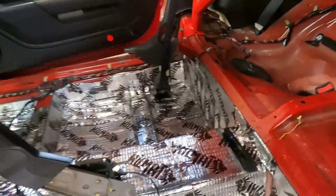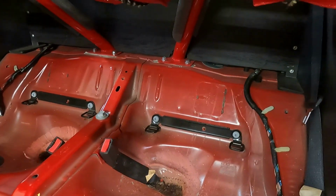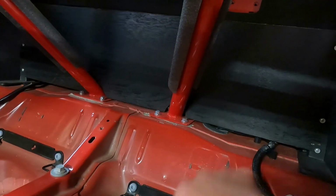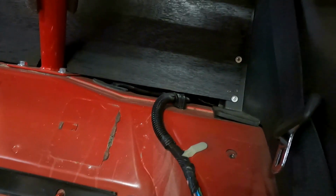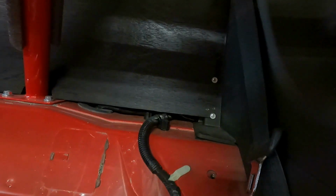Well, that got her done all the way up to where the back seat starts right here. It goes back in there, and it's a big old thick piece of foam, so I've got a theory that that's a pretty good sound stopper by itself. But when I put this piece of wood in here in the back there, because I had to take the back seat out and left that hole where the trunk is, I put a piece of wood right there, and look at that gap that I left. That's what I've been listening to the whole time on both sides with everything that's going on inside the trunk, because that piece of wood didn't reach all the way to seal up the trunk. So I believe I'm going to go in there and put some of this kill mat on the inside of the trunk where that gap is, and see if maybe that helps things out a little bit.